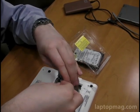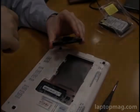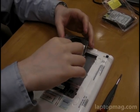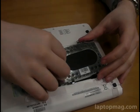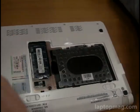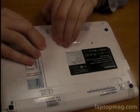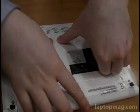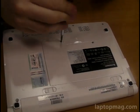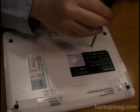We're just going to take a moment to fix the screws back into the bracket. Now that we've attached all four screws and everything is nice and tight, we're going to take our drive — teeth facing toward the serial ATA port — and just slide it right in, pull on the tab, and it locks into place. There's nothing else to be done except put the panel back on, snap it into place, and screw it back in. At this point, you'll want to either install a new operating system or do your system restore and enjoy the additional speed, power, or capacity that you're getting.